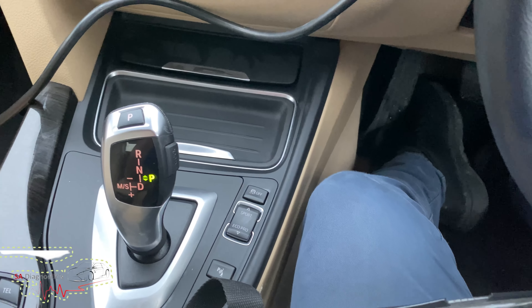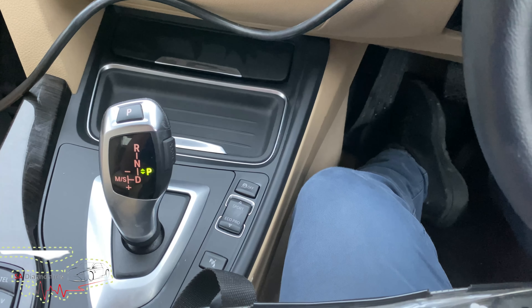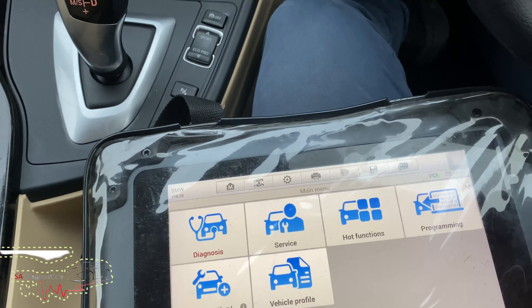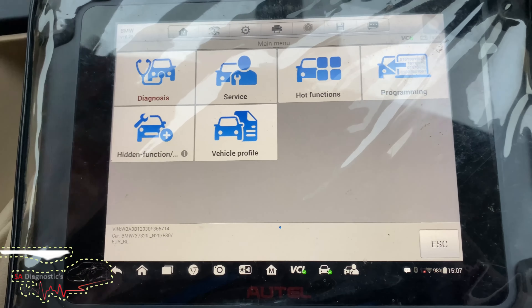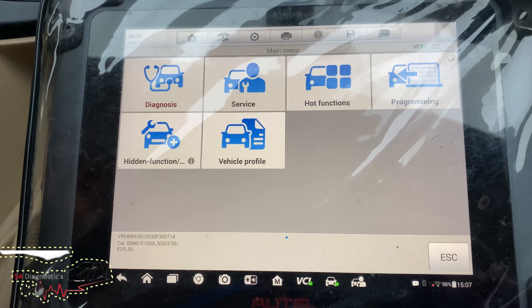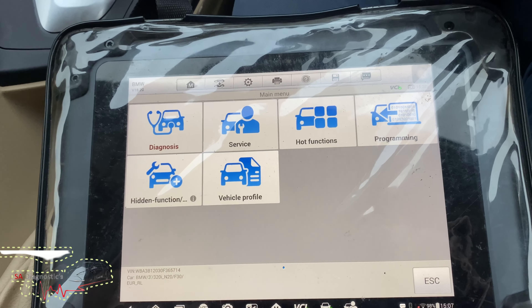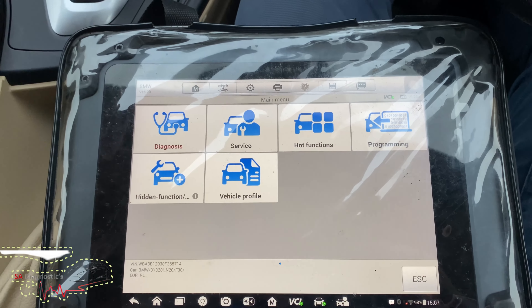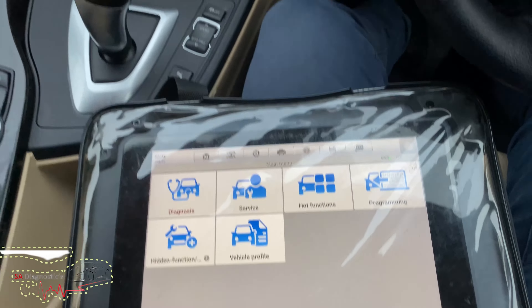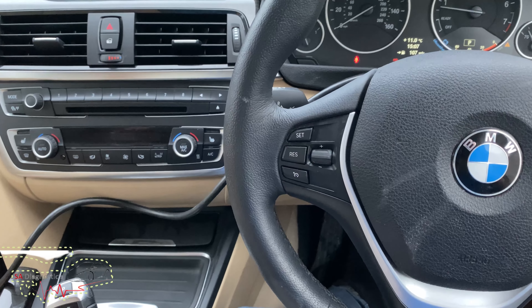It's a very difficult one to eliminate — very, very difficult. Personally I'd start off with the diagnostic machine, unless it brings a fault code, because the majority of the time — 90% of the time — it doesn't, unless it's low on oil. You can check the oil level on this or on the gearbox itself.